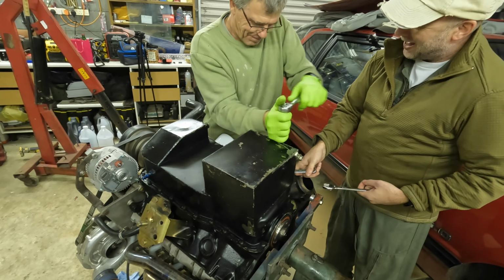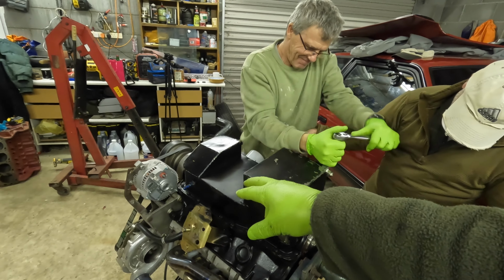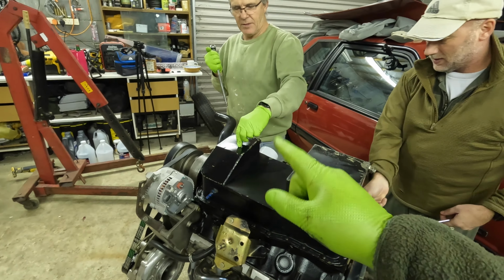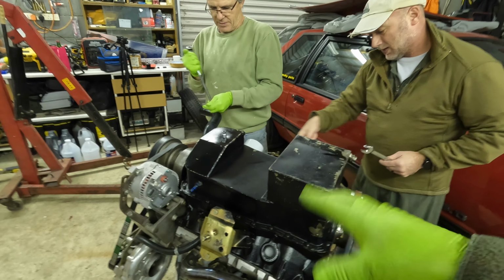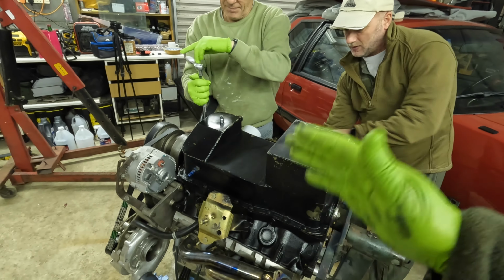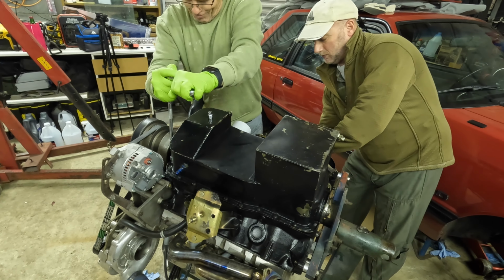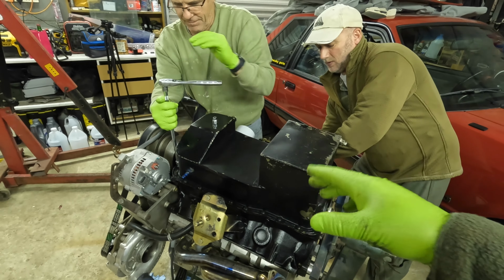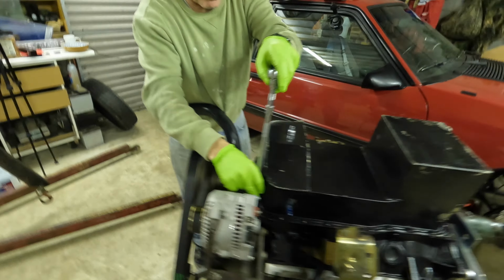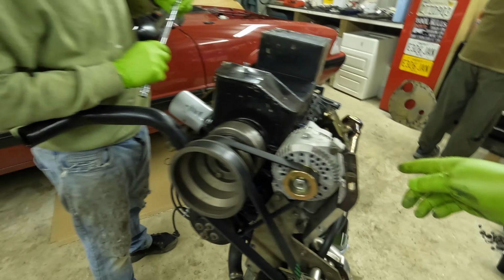Fix the oil pressure. We are replacing the oil pump. And this is one of the instances where we figured that a high volume oil pump is going to fix the problem, because when the oil warmed up, it had low oil pressure at idle only, and it was fine once you came off of idle and you were driving it, but we had to use 20W50 oil to maintain that pressure. So we have a supercharger, which is taking oil.